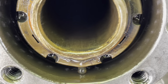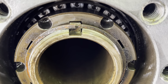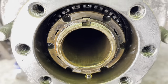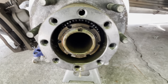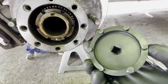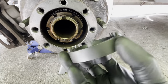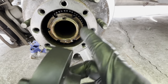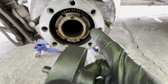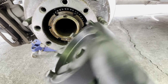Go ahead and undo this snap ring — it's real simple, just lift up, pull out on it gently and it'll pop out of the threads. Slide the block out. Then use tool 5045 or similar — it's machined to go right in there and should only be finger-tight really, because it's 22 foot-pounds when you go back together. That's why you need this tool and a torque wrench.